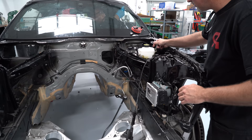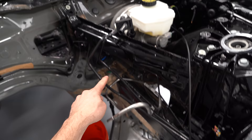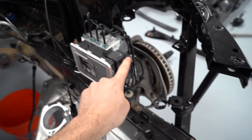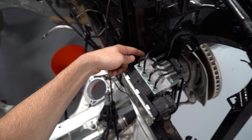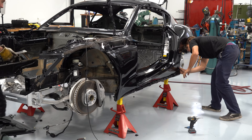The way the brakes work on most of these cars is when you push on the brake pedal, it puts pressure on the fluid system through the master cylinder. Fluid from those lines goes through the ABS — there are four lines that come out of the top of it, each one for one of the four wheels. We're actually not going to use any of the anti-lock braking; we want the driver to be able to lock up the brakes when he wants.